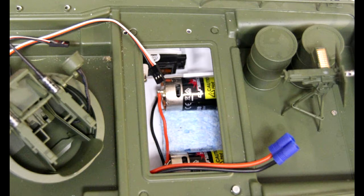The reason for relocating the receiver is twofold. One, I want to get it out of the water, and two, because I'm moving the antenna, it lets me get a higher location for the antenna and makes it a little easier to do that. As far as the water goes, you've probably noticed if you have one of these boats, they do take on water, and it sloshes around in the hull, which doesn't thrill me with all the electronic components in there.